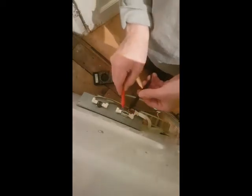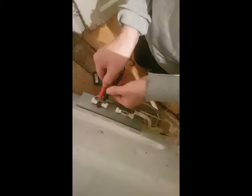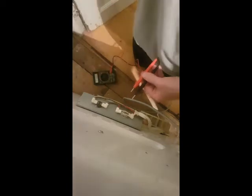through this thermostat. So it's staying on 1 and I'm getting nothing, no readings off that. I'll check my other thermostat. So I have continuity through there. Just double check. Okay, so I know I need to replace this thermostat. Alright, just one more check. So I basically know that I have a problem with this thermostat.